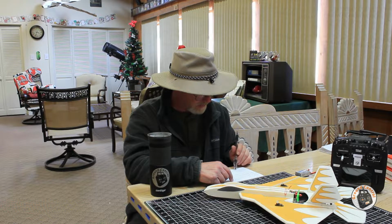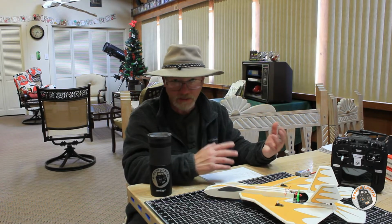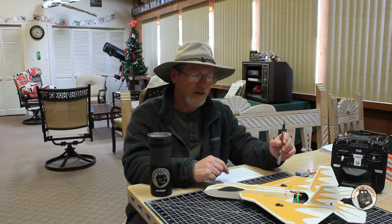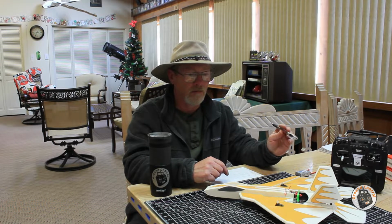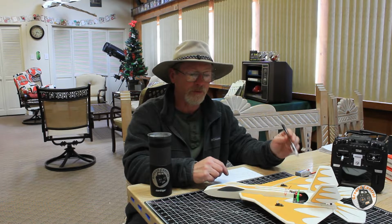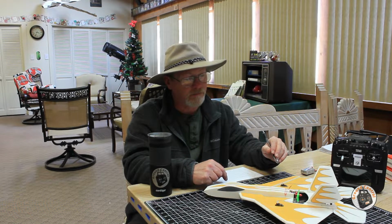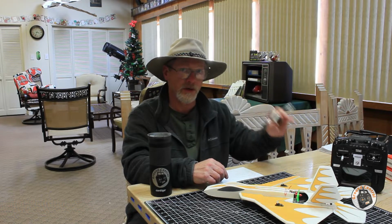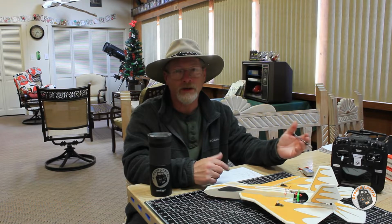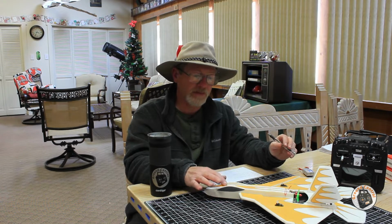So, the way I fly, and you saw the video, I'm cruising around probably 2/3 of the time, and I'm heavy on the throttle about 1/3 of the time. At 70-30, I should be able to get 8 minutes of flight time out of this, leaving 3.5 volts per cell. I think that's pretty good, considering the maneuverability of the plane and the amount of power that it has on a 3S 550 milliamp Lipo. And with the thrust to weight ratio, even with this little heavier battery than what I had been flying in it, 1.83 to 1 is still going to give you unlimited vertical until your battery starts falling off.